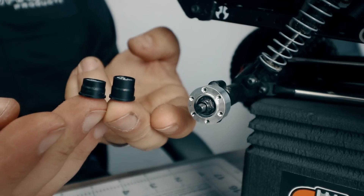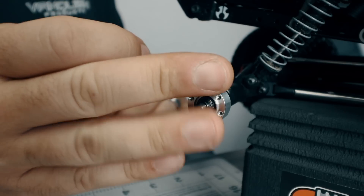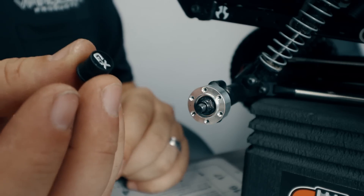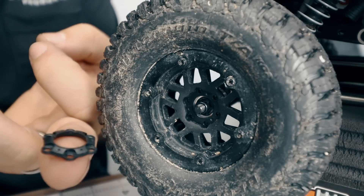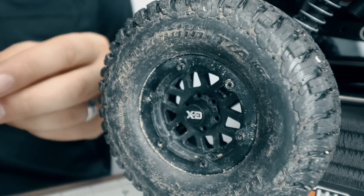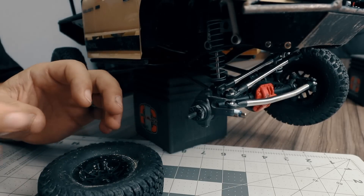It's just a small difference, but the reason for the wider cap is to make sure the stick-out on the axle thread itself doesn't push on the inside of the cap and prevent the wheel from sitting securely against the hub. The number three hub will pretty much clear, but just to be safe we're going to replace the old narrow cap with this slightly deeper wide cap. We'll place the wheel back onto the axle, install the wide center cap into the reinforcing washer, and replace it all back onto the center of the wheel. Then we reuse the screws that came with the wheel to attach it onto the new aluminum hub.